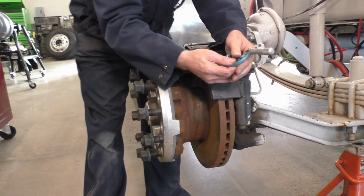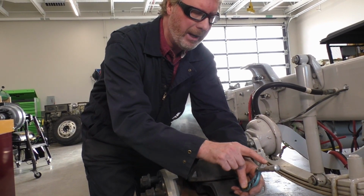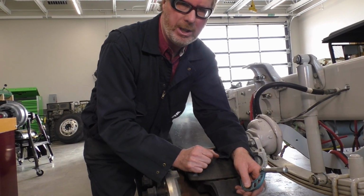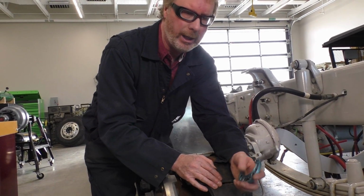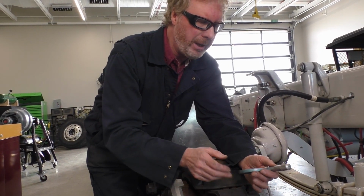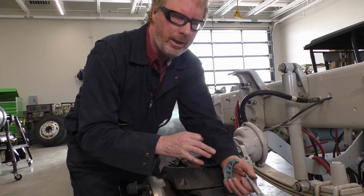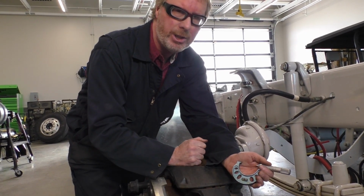So what I'm going to do is I will take pictures as I've done in other labs. I will show you the measurements. You can determine what the measurements are. So I will post that online for you because obviously I've got to get a deeper micrometer. All right? So that'll be our 4 different measurements that we'll be taking: 3 with the dial indicator, then 1 with our micrometer, 1 to 2 inch.